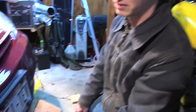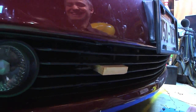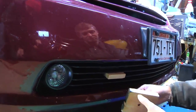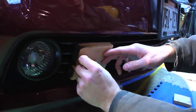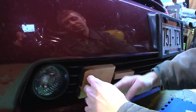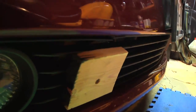Now you have a piece of wood that you can mount whatever you want to. We're using a one-by just because that happens to fit through the slot — a two by four would not really work for this application. The other nice thing is you can use whatever thickness wood you want on the outside to space your grill block out. This happens to work out nicely so that when we mount the coroplast it'll mount flush with the rest of the bumper. Definitely don't use a two by four on the back because it's not going to fit through the grill.